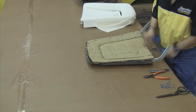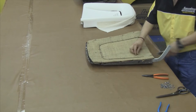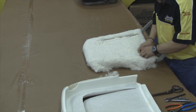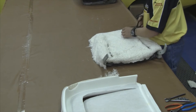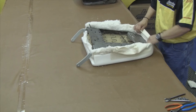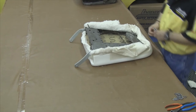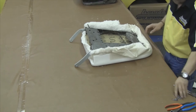Notice Randy has it along the bottom edge where that 45-degree angle is. Repeat the process on the top as you did on the bottom, putting a layer of cotton and splitting the cotton exactly where the paper-coated listing wire is. You can split it with your hands or cut it with scissors. Then set the molded foam over the top of the cotton and secure it to the seat frame, doing the top edge and then finishing off the sides.